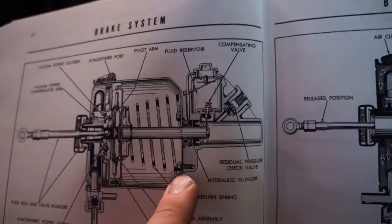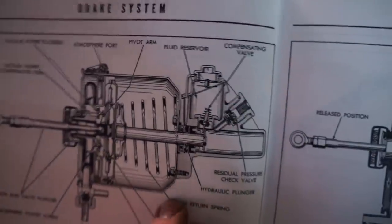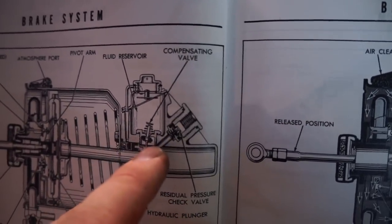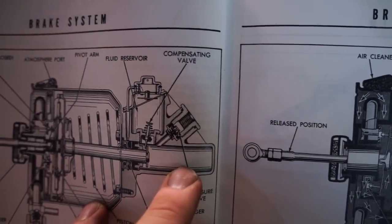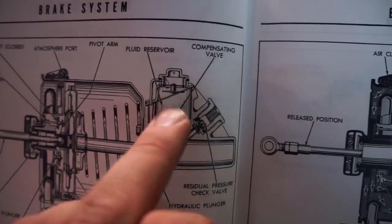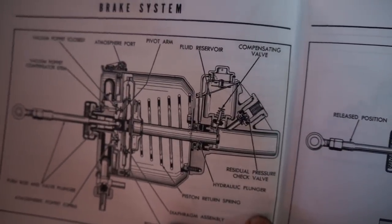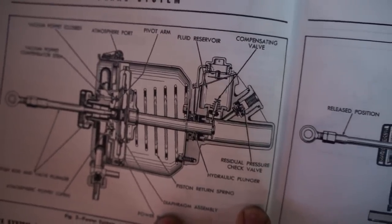The bolts to get the master cylinder off, for whatever reason, are enclosed in the whole workings of the system. But this shows pretty good what a treadle actually is. Apart from completely cutting this one away, you can see in the picture, your fluid lives in here. There's a little valve that sucks in there. Instead of a whole plunger going in there, there's just a rod that displaces fluid. That's kind of nice. There's two seals. The main one leaks, and the fluid goes back through this nice little dipper tube back into the top. Kind of a pretty good invention, I think. Or maybe not, because they don't use them anymore. And I'm hoping the vacuum stuff, it seemed to work when I drove the car around. It was just really sticky, so hoping to just clean it all up and not have to get a rebuild kit.